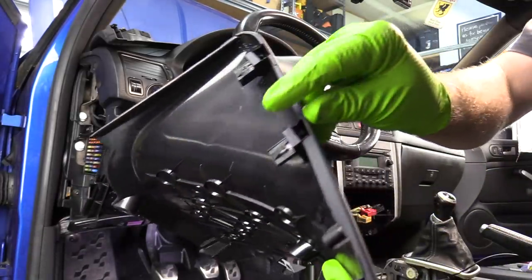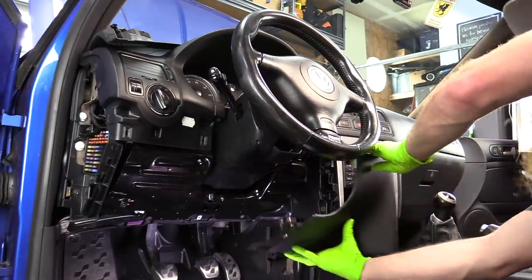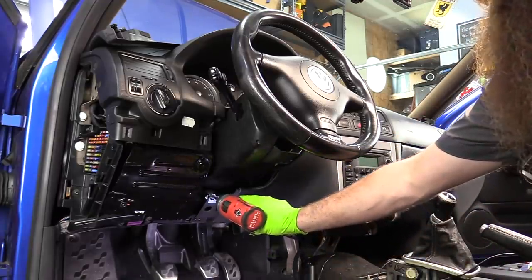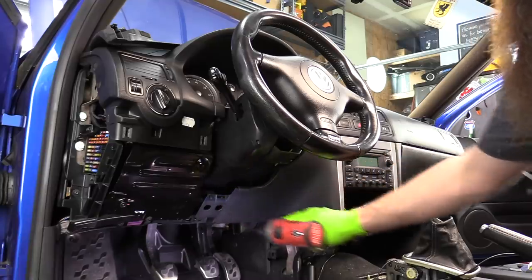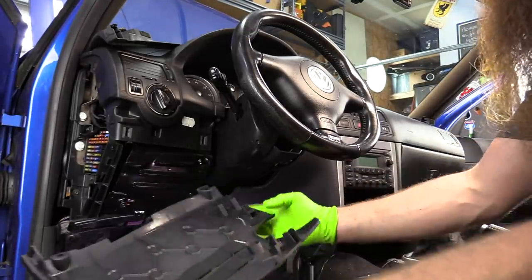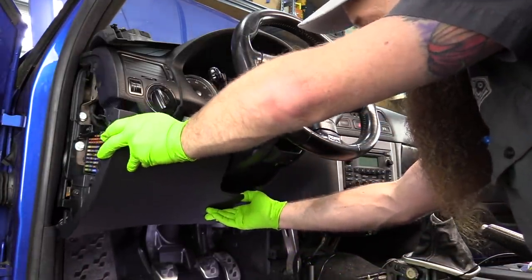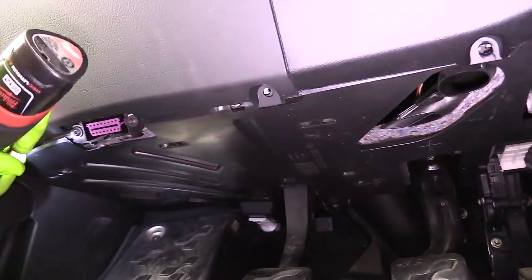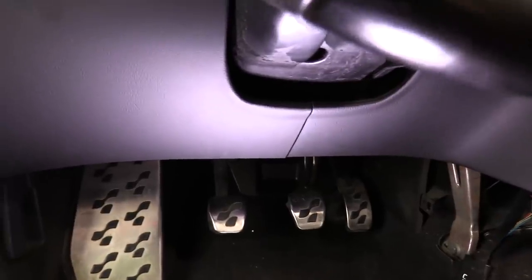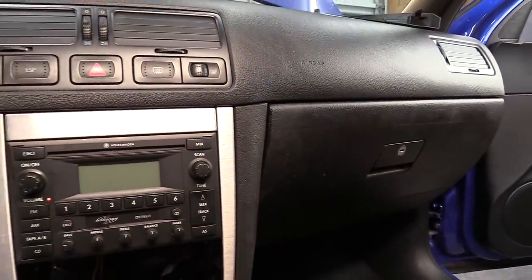Let's start with our trim closest to the passenger side. Here are our new clips that we just removed from the old trim, and we're just going to take this piece and slide it right in. Put this screw in right here. Next we'll take our outer trim and go ahead and install that — there are two tabs that go into those two holes. Then we'll go ahead and put our three screws in at the bottom. There is our new lower driver's side trim — our brushed trim fits properly and the glove box sits a little bit nicer.